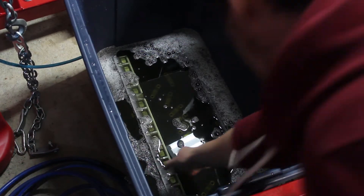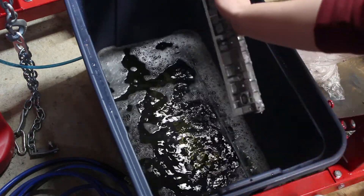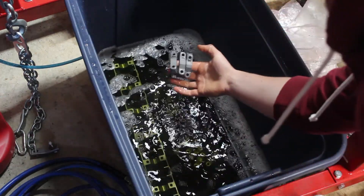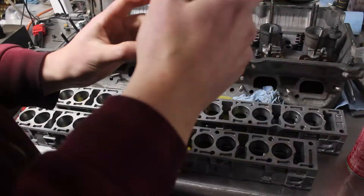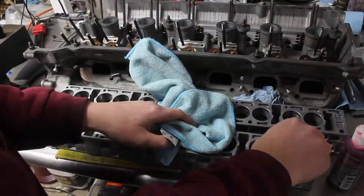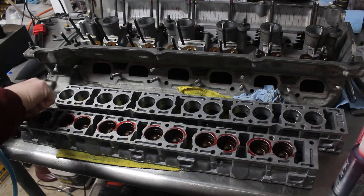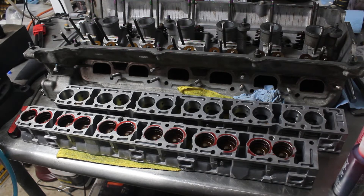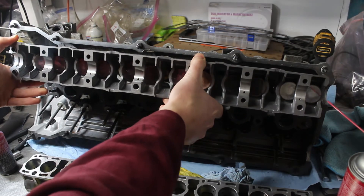I started a new cleaning bucket since the old one was cold and dirty. The cam and lifter ledges cleaned up beautifully, along with the cam caps. The lifters got some lube and then they fell right into place. I didn't disassemble or clean any of the lifters — my excuse is that they probably don't need it, but at the time I didn't even know I could take them apart. With all the lifters back in their spots, the ledges could be reinstalled.